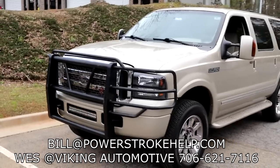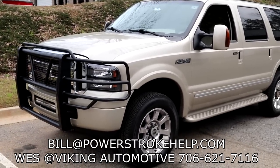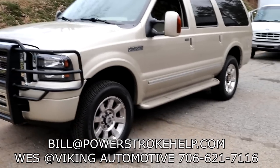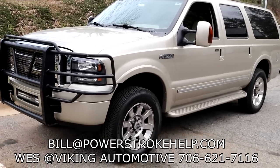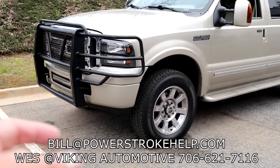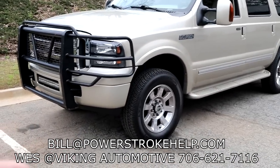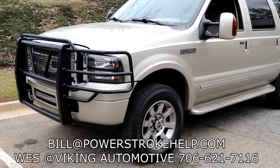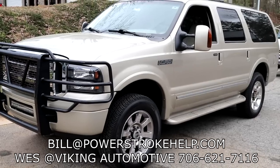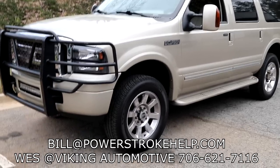I sold this Excursion — this is a Big Dog Ultra that I sold about two years ago — and we've had some death wobble issues with this truck. The man that owns it is pretty meticulous, a good technician. We put in a tighter steering box, and one of the things we do with the alignment is set zero toe. Factory Ford likes to toe in about half a degree, which settles the steering wheel at speed, and you can run a looser steering box if you toe in. If you set zero toe, your tires double in life.